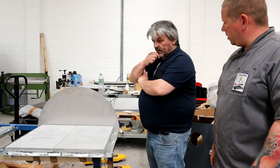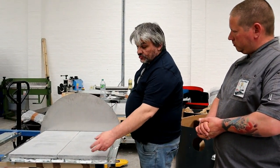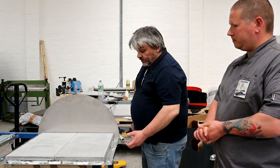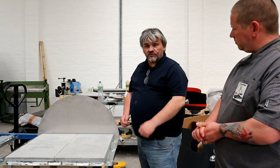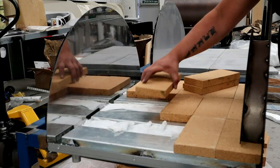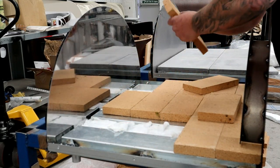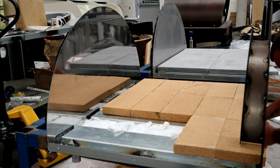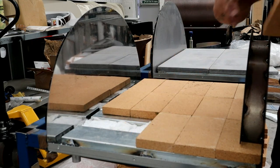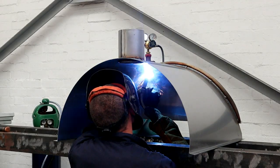How easy are they to actually change, Dave? The Vesta has got a strip on the front which you simply unscrew and take off, take the fibres out — the fibres will come out on their own. The Vesta Plus and the Vesta are about 75 kilos so they're quite heavy. People are often surprised — they take the tiles out and the oven is still very heavy, so it's not always a benefit. You can retrofit the tiles if need be. The bricks are probably the best seller by 3 to 1 — they still have a function. The clay bricks last a very long time and are easy and cheap to replace. But we've made the Vesta Plus as a premium version with a stainless front, stainless back and tile base.